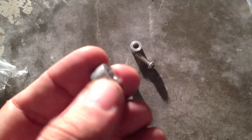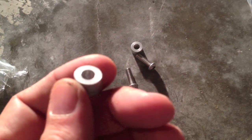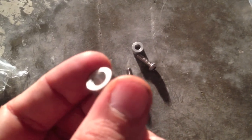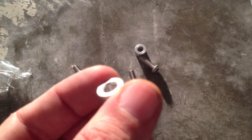The little spacers, if you look at them, have a chamfered edge. This inside circle — looking on the inside of the donut here — is very smooth, not chamfered. That one is chamfered. I really don't know why, but the instructions are explicit that that chamfered edge go against the cylinder head. So as we come up here, that chamfered edge will go just like that — chamfer under the cylinder head.